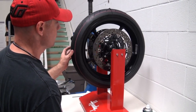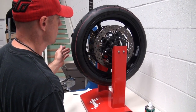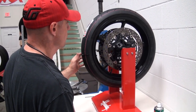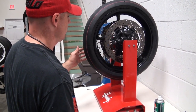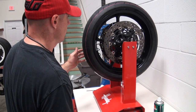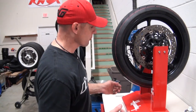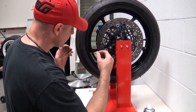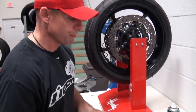What we're going to do from here is rotate it into a couple of different positions. And that's a nicely balanced assembly. From here I'm going to go ahead and peel back the rest of the tape and stick it on there nicely. I'm going to cover it with some duct tape, and that just ensures that the wheel weights are going to stay on the rim.